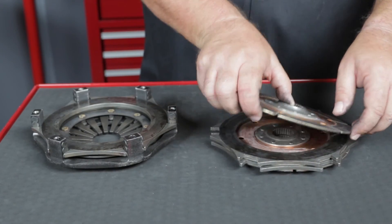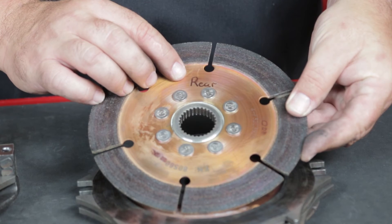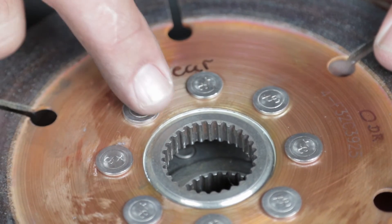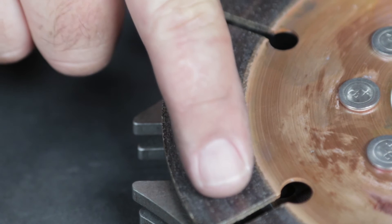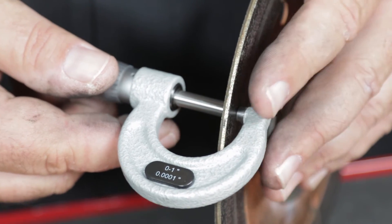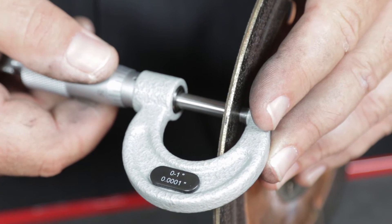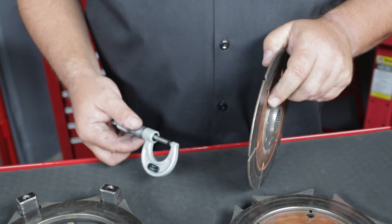Take the top clutch disc and, if you did not do so when the clutch was new, mark the order and orientation of the clutch discs with a permanent marker. Inspect it for worn splines and cracks in the key hole slots of the core plate, both of which are an indication of gearbox misalignment. Inspect the friction material — it should be intact and generally smooth. Measure the thickness using a micrometer. Clutch discs start new at one hundred and four thousandths of an inch thick. Discs should be replaced when the total pack wears thirty thousandths of an inch.